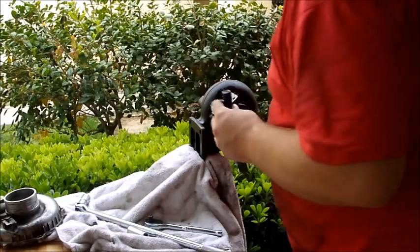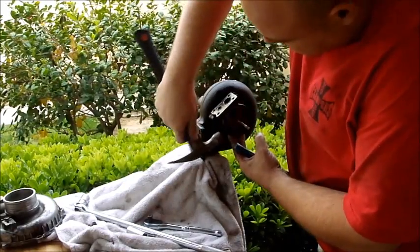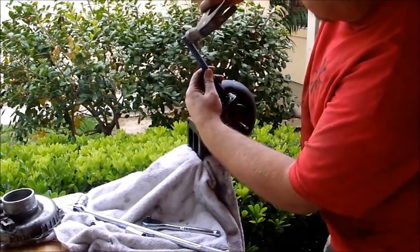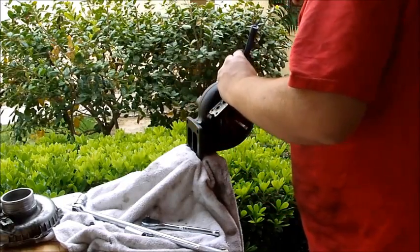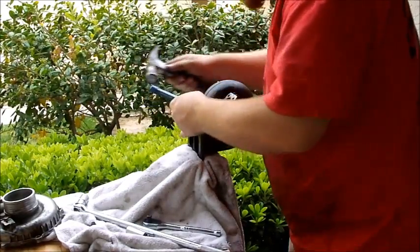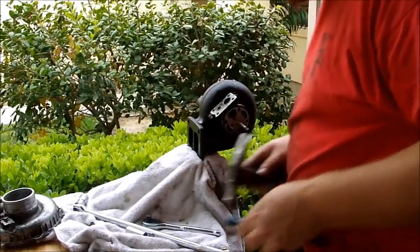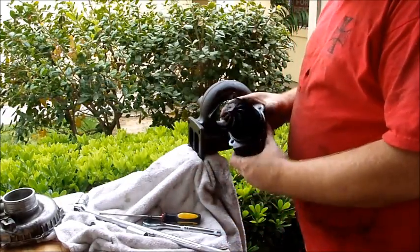To get this next piece off, you want to tap it lightly all the way around — and when I say lightly, I mean incredibly lightly. I'm going to tap it with great finesse. I'll stick this wedge in here and hit it gently, just kind of pop it forward a little. They're not magically stuck together — they've just been through a lot of heat cycles. You don't want to damage or chip anything. Once you've got it on the move, just tap it a little to separate it and the center carrier comes right out.